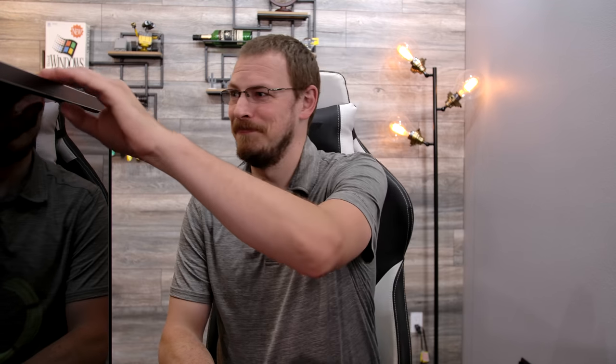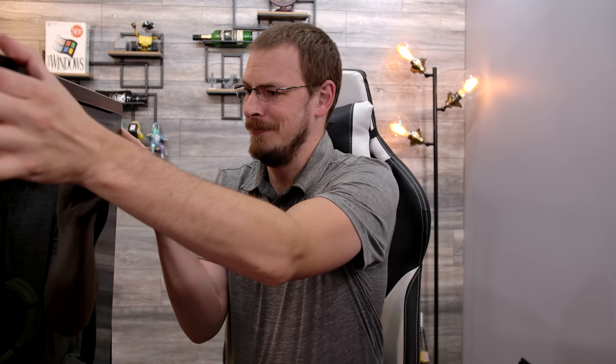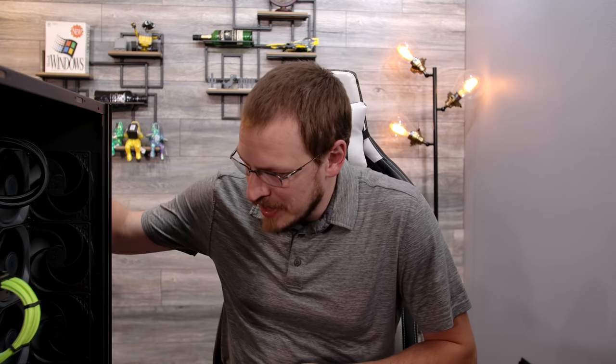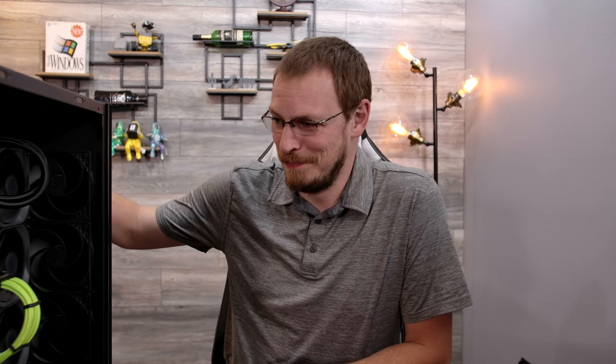We're getting a postcode of 96 here. The board is refusing to boot. So I think I'm gonna do a CMOS reset. See if that works. Hopefully I didn't just brick this. But hey, that would make the end of a video, wouldn't it? Yep, same 96. So we're gonna hopefully clear the BIOS and not brick this computer.